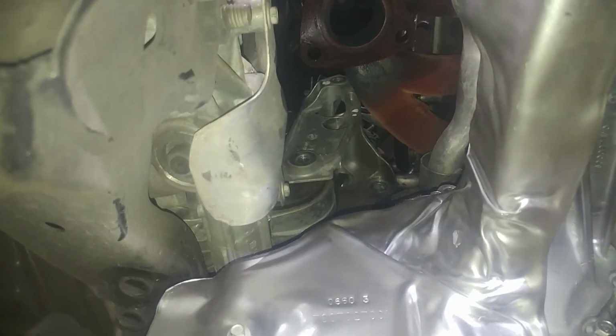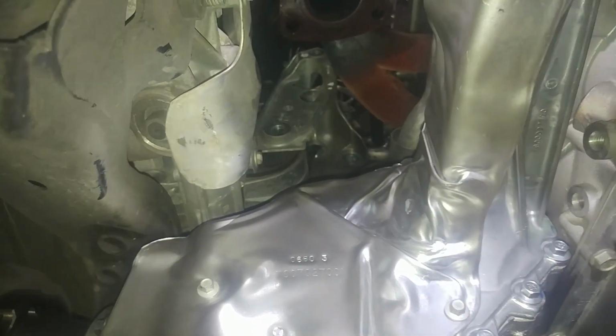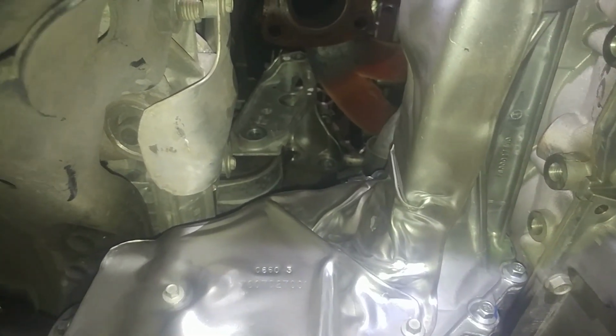Boom. So I'll reach up there and drop that transmission mount bracket back into place and hopefully get all those bolts in there lined up properly. And one suggestion I have for you, maybe they're different lengths, maybe they're the same. We find out they're mostly the same, but I still marked them. One's marked with black. This one has 2 dots on it, and this one has nothing on it. That one's obviously a different size, so I made some different marks on there so I can put them in the right holes right away. Put some marks on that transmission bracket.